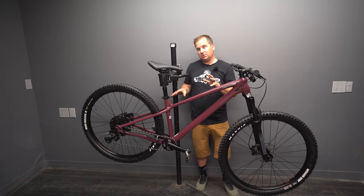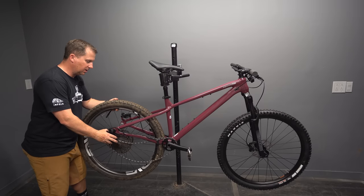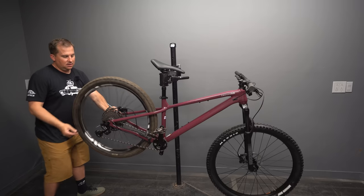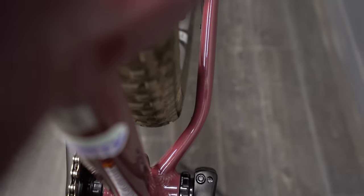One other thing we need to do is see if this will fit a 2.6 tire in the back. So here is a 29x2.6 on a 40i rim. That's wider than most people will run. Oh man, that fits all day long. Oh, that's wild. That's over a centimeter of clearance there.